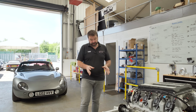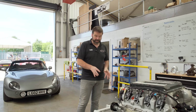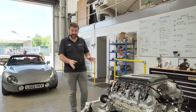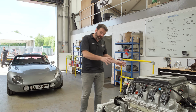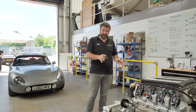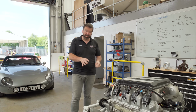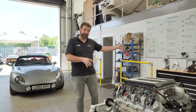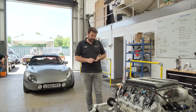And what you're trying to do is control that roll centre and the migration of the roll centre. So that roll centre doesn't stay in one position. As the suspension moves, as the car moves, the roll centre migrates. And so what you're trying to do is control that movement. And we found with the Griffith and Chimaera that the roll centre migration actually went off the screen on the software as we were analysing it.